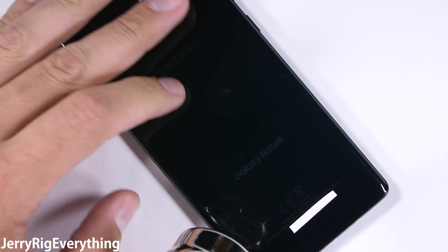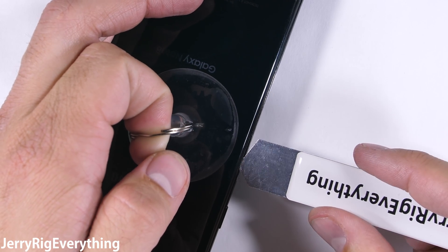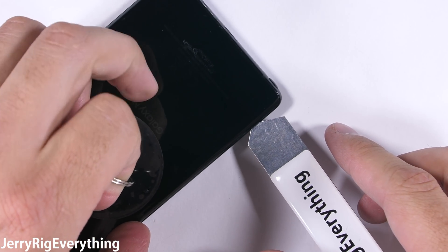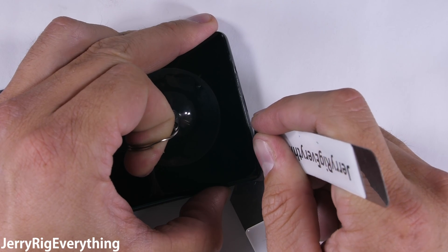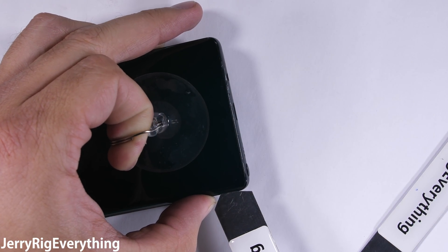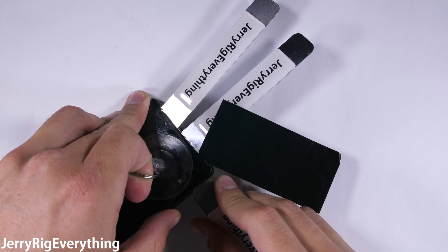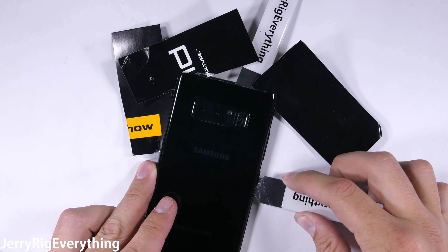The phone is turned off at this point and I'm warming it up until it's too hot to touch comfortably. Then I'll slip a thin metal pry tool along the side edge of the glass panel since that's the only entry point I could find, then gently cut away the adhesive under the glass with that metal edge. Remember, we're working with glass so any pressure in the wrong spot and the whole panel shatters — it's a delicate process. As the phone cools the adhesive hardens back up, so I'll be reheating the phone every 30 seconds or so. Tucking a sturdy piece of paper or business card under the glass also helps keep it from re-adhering.